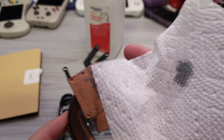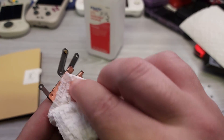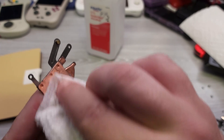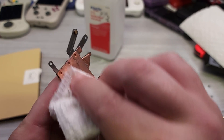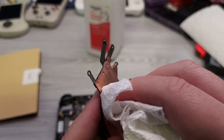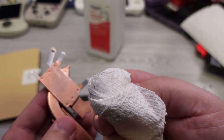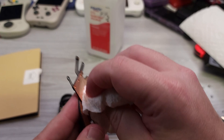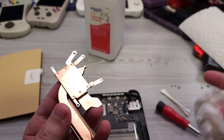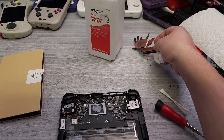You want to really get in there because any dirt or residue will impede the flow of heat into the copper, which then impedes it through the heat pipe and so on. Keep cleaning until you don't see anything. There's going to be a grain pattern you'll want to address — the best heatsinks are mirror-lapped. You basically want it as clean as possible. PTM7950 will fill in those micro gaps; that's what thermal grease does. It fills the gaps so there's no air — air is an inhibitor that insulates heat and keeps it on the processor, which is what we don't want.